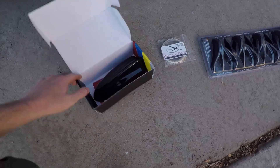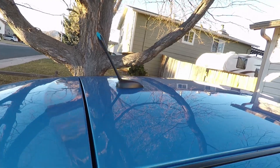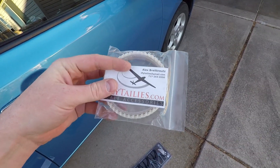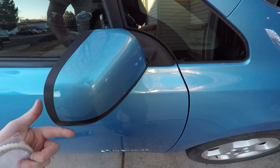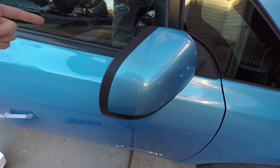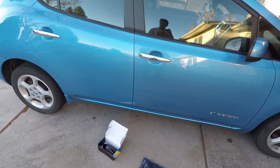Also what I've got is a shark fin type antenna, and I'm going to replace the little pencil bobbin antenna with the more aerodynamic shark fin. And then lastly I've got some tape — vortex-generating tape for radio-controlled gliders — and I'm going to use this around the trailing edge of the side view mirrors, all the way around front. What that's going to do is similar to the Kamm back effect: it will create vortices that make a smaller effective trailing edge around the side view mirror to increase efficiency.